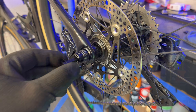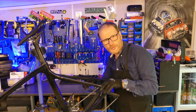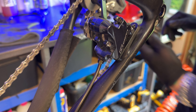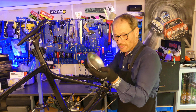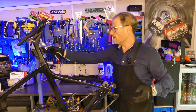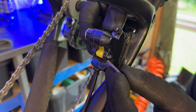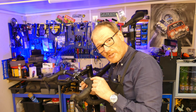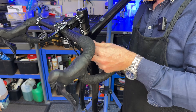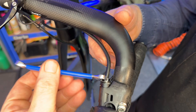This is the bike I'm working on, running Shimano Ultegra 8000. First job: take those wheels off because all they're going to do is get in the way. Let's also take the pads out, because when we disconnect that hose, hydraulic fluid will flick out and contaminate the pads. Workshop top tip: get yourself one of these little magnetic parts trays to put things like those little clips in — stick it on there and you won't lose anything. Good practice whenever you take your pads out — always put a bleed block in their place. Next job is to wind the bar tape off and peel the hood back. Then, using our eight millimetre spanner, let's disconnect that hose from the lever.